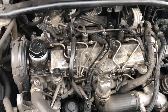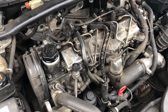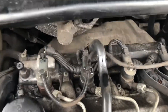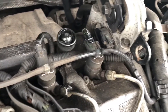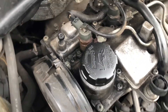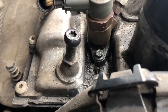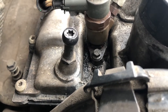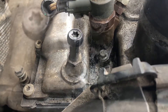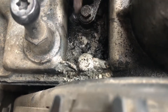I'm investigating a rough running issue with the Volvo and I think I'm going to have to remove an injector. If I have a look at all five injectors you can see they're all pretty dry in there, with the exception of one — there's a wet black gunge there. Basically the symptoms are the car runs generally okay when it's warmed up but when it's cold we get a partial misfire, it's not a full-on cylinder down. With this being an end injector I've used a bit of blue tack.